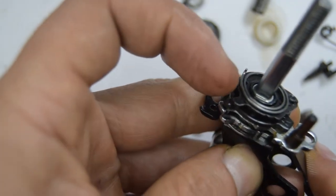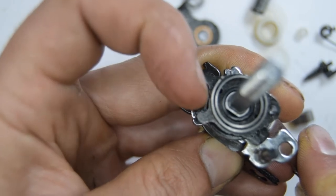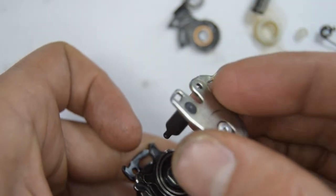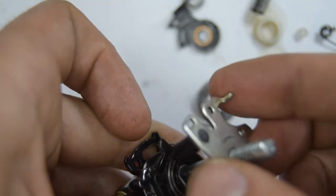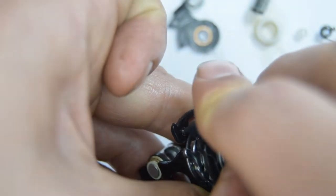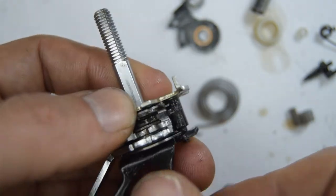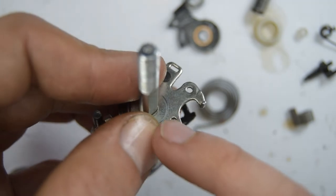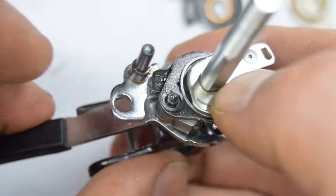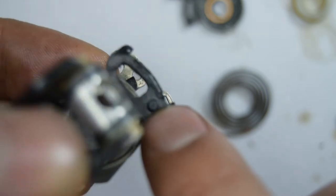Using the arm, if everything you've done is correct, it should tension back - there will be the return spring putting it backwards. You want all these little four parts here sticking out to be behind there, so when you push that pivot part through the shaft it's going to hold all these backwards. Don't worry about that return spring we just put in - we're going to be reclining that part in afterwards. Pushing all those back holding that lever. Now on the other side there's a tiny little circlip that we need to install.